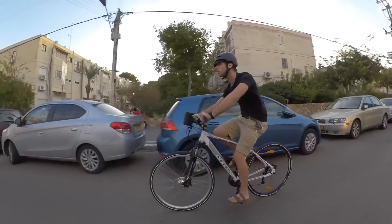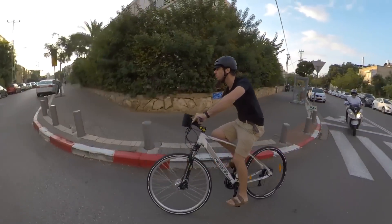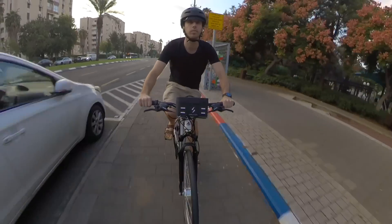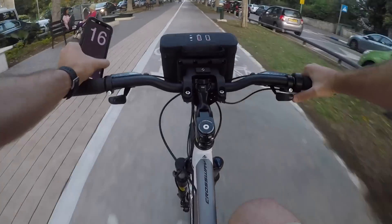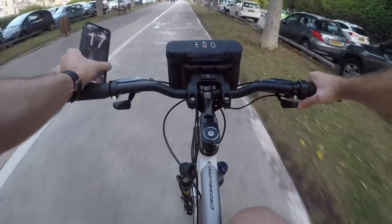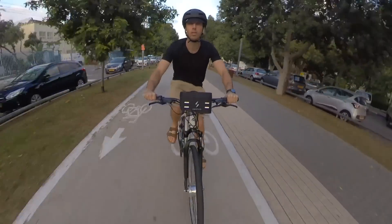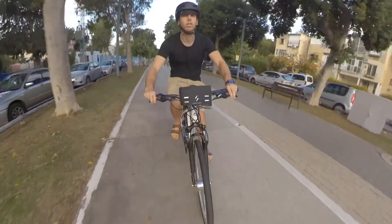When it comes to power, there's not a ton of it. This is a low-power kit designed for commuting and traveling at city speeds. It definitely gets me up to 20 miles per hour whether I use the pedal assist or the throttle, but I don't expect it to climb any big hills on throttle alone. I did a speed test on throttle only on a small hill at about a 5% incline, starting from a stop, and I could maintain about 18 or 19 miles per hour with my 20 mph kit. If the kit can keep up 90% of its speed on a 5–6% incline, that's some decent torque.